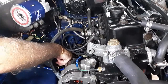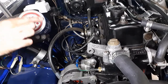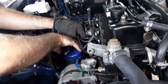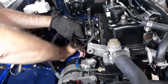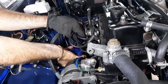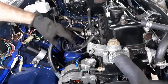Got things cleaned up again. We're using the Purolator PL14670 oil filter. Let's get a little bit of clean oil on the gasket here. And we'll just hand-tighten it so I can get it off again next time. I wrote the mileage — 54,165 miles — on the filter.